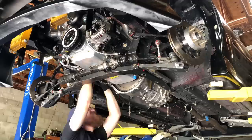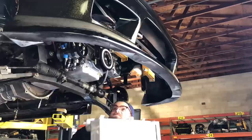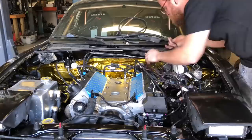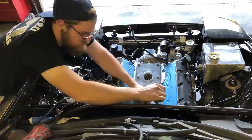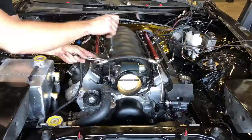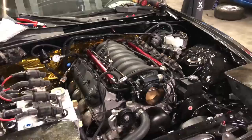Maybe not quite ready for burnouts yet — with the engine and subframe and trans back in the car, it's time to do all the little stuff: hook up power wires, put the radiator in, bolt up brake calipers, hook up suspension, reroute the wiring harness to all sensors, injectors, and connectors, install the intake manifold correctly, get the throttle cable back on, coil packs, plug wires — all the little tinkery stuff to get this thing running again. The goal is the first start of the LS Miata with its new engine and dry sump. Before first start, the very last project is finishing the dry sump lines — the pump is on the tanks, lines are made from the pan to the pump, but we still need lines from the tank into the pump, through the oil cooler, through a remote oil filter, into the engine, and back.